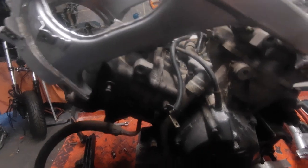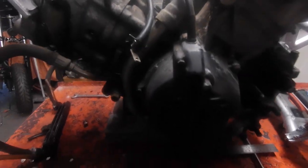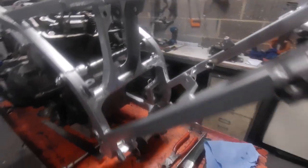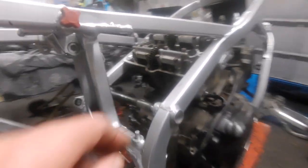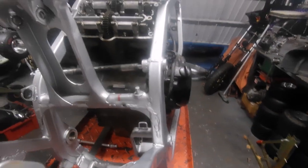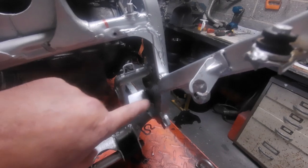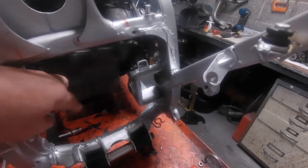What I propose to do, be it right or be it wrong — that little lug on the front engine mount there may have to come back as well, but we can try offering this side section up. That's detachable so it can be looked at. What I'm proposing then — I've been and got some threaded bar. I need to widen things. Let's talk about the swinging arm first. This section here I'm going to have to remove because the swinging arm just has two fold lugs on it with a cut-out in the middle for the exhaust.